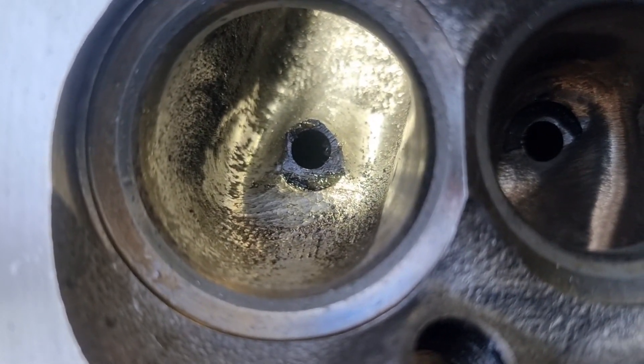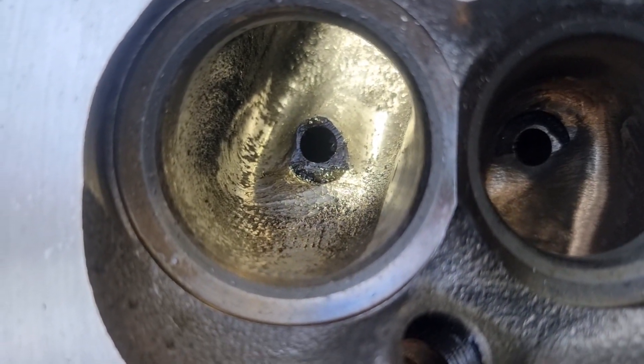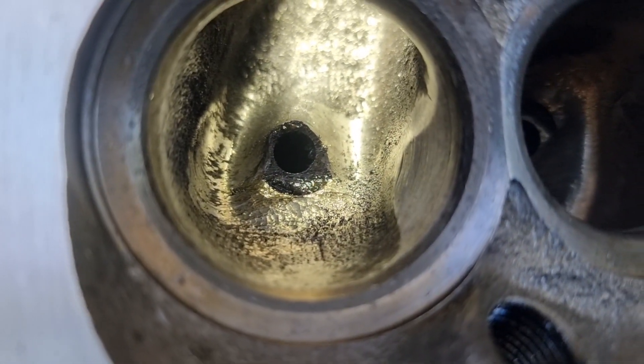Here's one I've just gone through — just trying to smooth it. You're not trying to take anything out, you're not trying to hog it. You can see the parts of the port there where it's still stock port — it's not even gone that far.